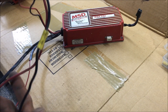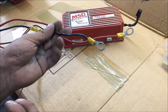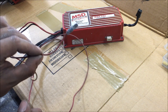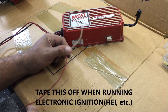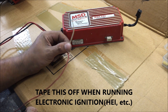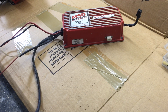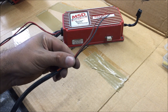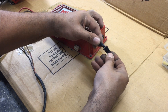They have wiring diagrams on the back. The heavier, thicker 10 or 12 gauge wires — he just had these wires straight to the battery. This smaller red goes to ignition on with the key; he just had it stuck in the bulkhead connector on the firewall. The white wire you're going to use on a points ignition on the little wire coming out of the distributor going to the negative side of your coil, so we're not going to be using that. The only things we need to be paying attention to are the orange and black coming out of the box, and the purple and green coming out of the box.